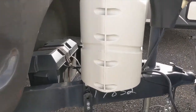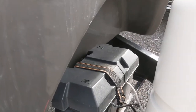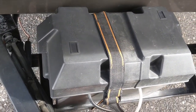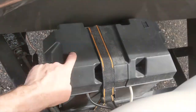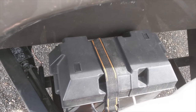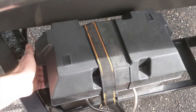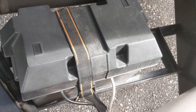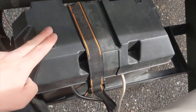Whenever you can, if you've got your batteries up front, you kind of want to deal with it and work with them. One advantage we have in this travel trailer is that we do have room for a second battery. This is a group 27 battery box with only a group 24 battery inside — rated for about 100 amp hours, though who knows what it's got now since this thing is used. There is room in the tray for a second battery, so I've ordered a dual battery box from Camco and I'll be putting two group 24 batteries in it, basically doubling — maybe tripling — my battery capacity.